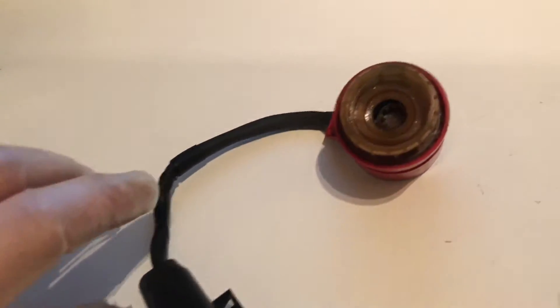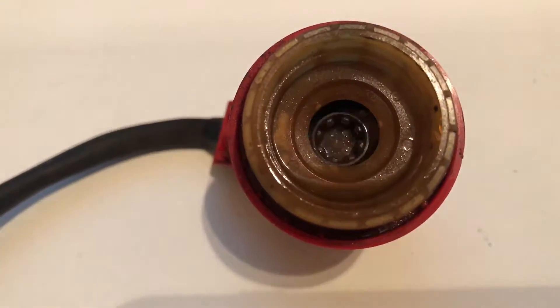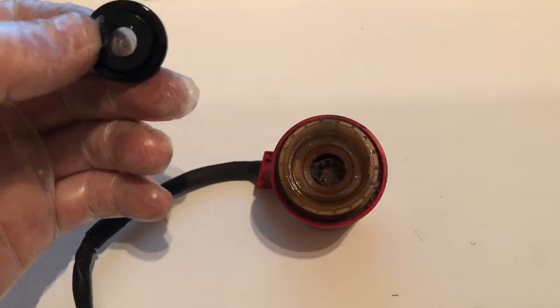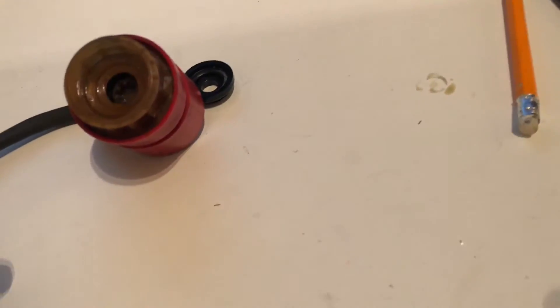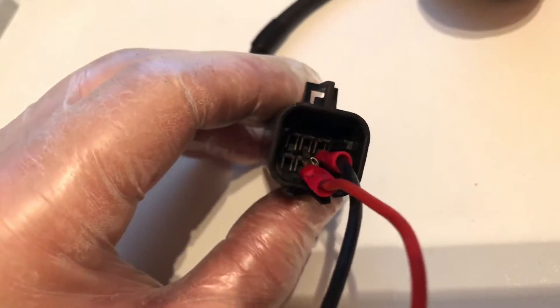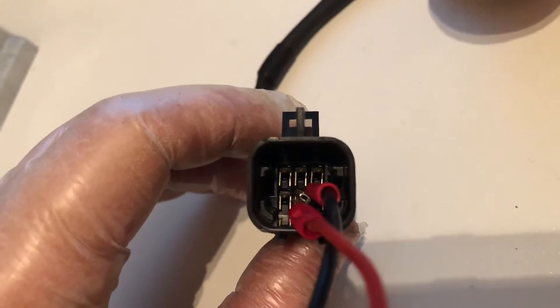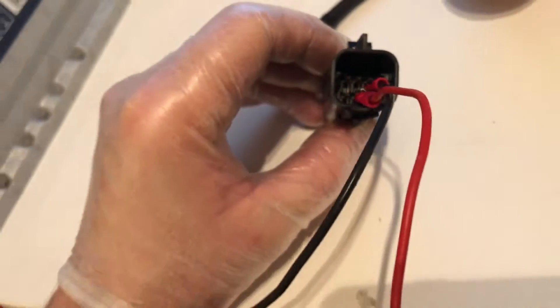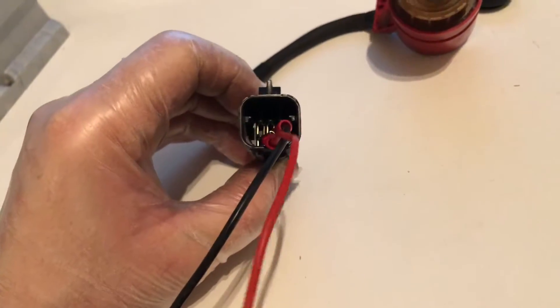What we're trying to do is test the movement of this actuator. There's a little rubber grommet that sits in there normally — that just pops out. Then note the orientation of this connector, which is the clip you attach to the part of the car loom.